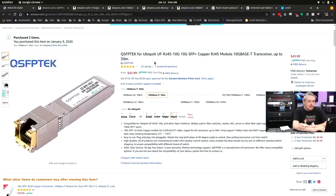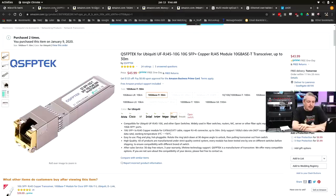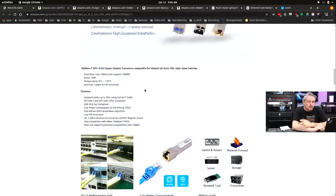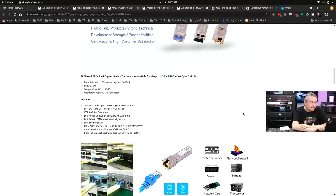Someone will point out right away that this runs hot, and they're not wrong. It's currently running at 54°C under heavy transfer, and I've seen it hit 59°C in heavy usage. But it's rated all the way to 70°C, so that doesn't seem to be a problem — unless you have a high ambient temperature to start with. According to the specs, it's good up to 70°C operating temperature, and I haven't seen it get above 60°C during full 10 gig transfers.